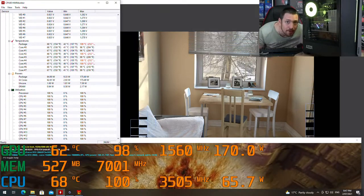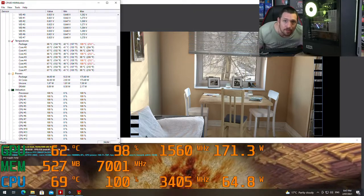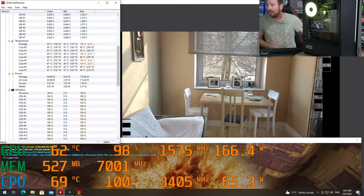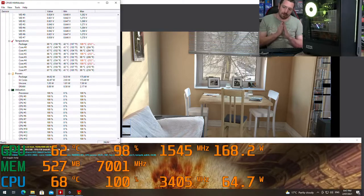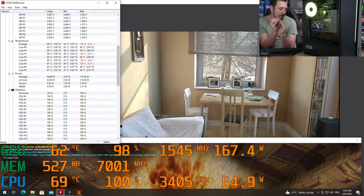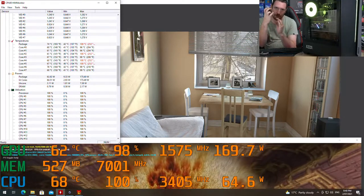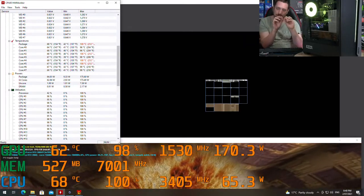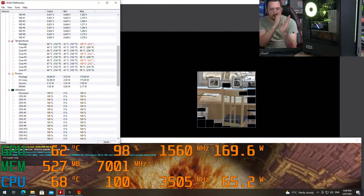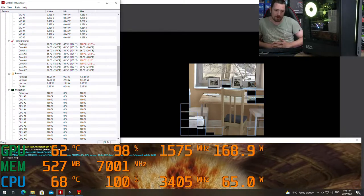Since I've fixed my bent CPU pins, could the CPU still work? They're not all bent now and all broken. Yeah, the pins themselves just make contact between the motherboard and the circuitry on the CPU. It's just a little bit of gold. So as long as you straighten the pins out, and all the pins are nice and straight and in line, and you can put it in the socket, chances are it's going to be completely fine.